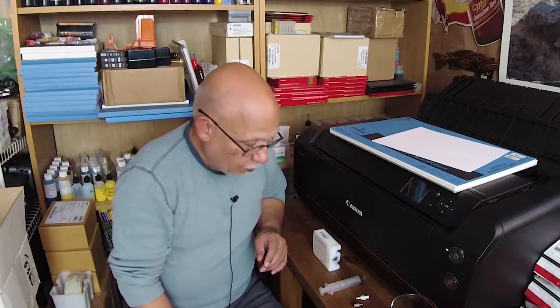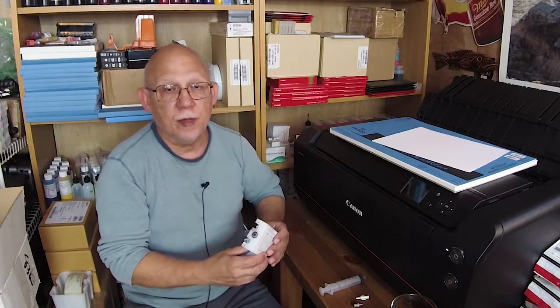Many of you have learned from me how to modify these cartridges. Why do that? Well, you can reset the chip, you get total ink level reporting, and you're using OEM cartridges, which is traditionally known to be the better way to go. What do I fill them with? Whatever ink I choose — third party from anyone, or like I do, I buy large format cartridges and aspirate the ink to refill my cartridges.